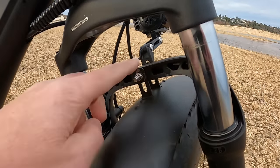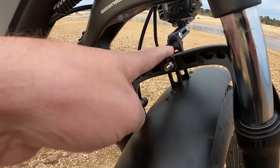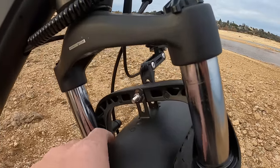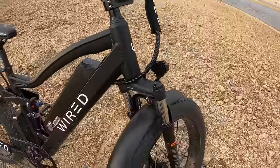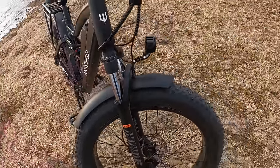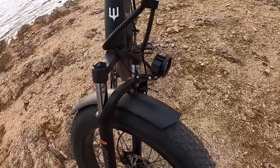You can even see some of the paint has come off back there from me putting a crescent wrench to hold this in place. You could use a deep socket as well on that. Even if you have a ton of friction, it's still eventually going to be able to move. I wish there was some way that this maybe came over the top — if the metal bracket went up and over, then it wouldn't be able to move because it would hit on each side of the fork and prevent it from going side to side. Because right now, even though it's pretty tight, it can still move. And when it does, you get rubbing on your tire.